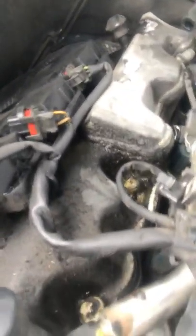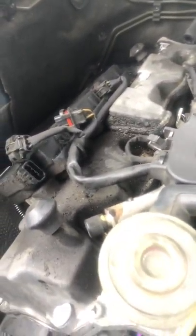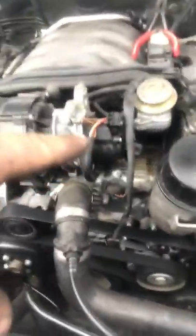Part two of the E320 Mercedes. And I found some more problems than I actually thought. This valve cover on top, this one, goes all the way back, has been leaking. I added fresh silicone on it, so I'm putting that back on. This side, you can tell it's been leaking for a while. That has to be changed out as well. That one has to be re-siliconed, cleaned up, thrown back together. So I'm going to take off all this, clean all that up. There's some oil leak right there. And then I'm just going to slap everything together.